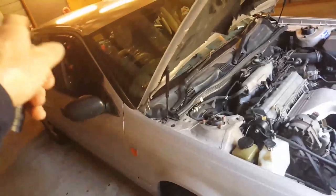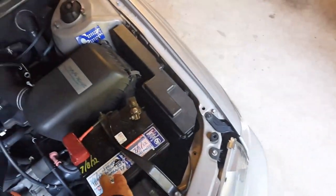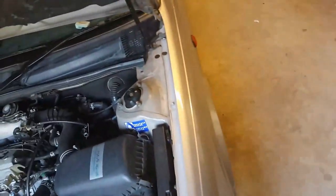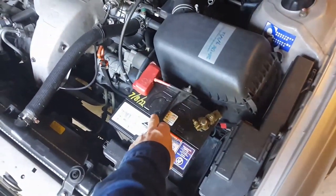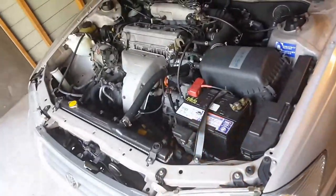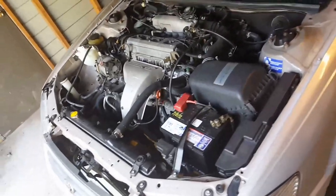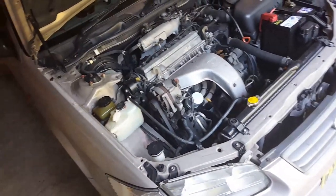About a month ago I was working on the third brake light and the battery did get low. However, I put it on charge and I drove to work and back for a week, and I'm thinking, after the week it still wasn't charged, and I'm thinking, what's going on? Do I have to buy a new gel battery if it drains of electricity? But no, the alternator's probably been bad for a fair amount of time. So, okay, well, until I get the alternator.